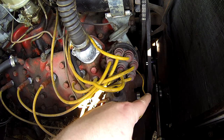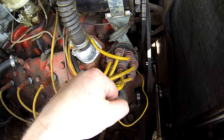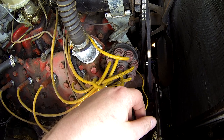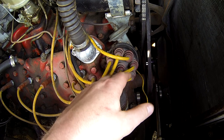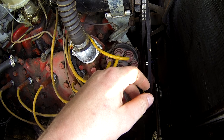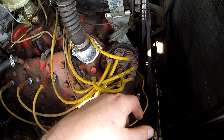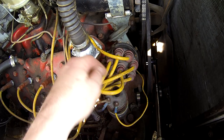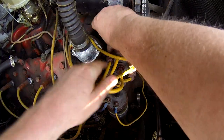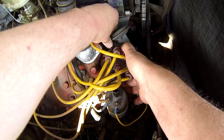I also found there's a bolt on the front of the crank and I have a breaker bar — I think it's 7/8. Because of the low compression of this engine — I think they're around 6.5 to 8 to 1 — it's easy to turn the engine over by hand even without removing anything. That's what I'm going to do when I go to set the points; I like to have a lot of control over that rather than just bumping it with the starter.